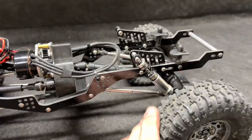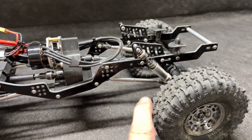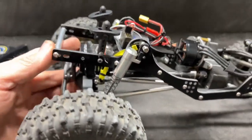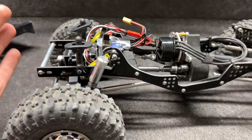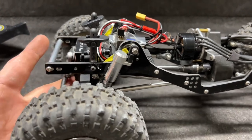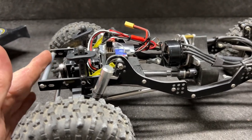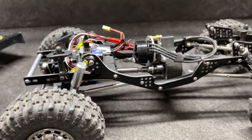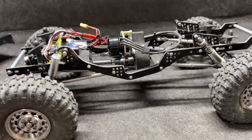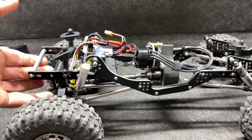I'm not putting anything in the back — I don't want to lose the droop I've got back there because I think I need all that. But this right here should hold the front down, and when I get up on a good incline it'll be sitting there. By keeping the front down and not letting it extend out, you keep everything closer to the ground, so your center of gravity doesn't change as much on a steep climb.